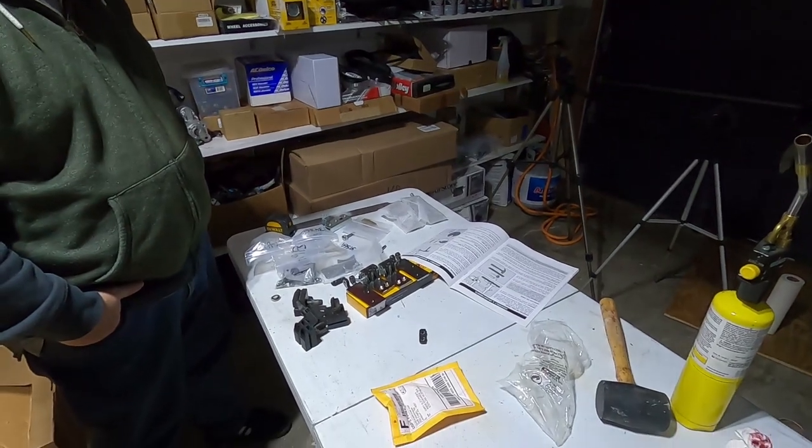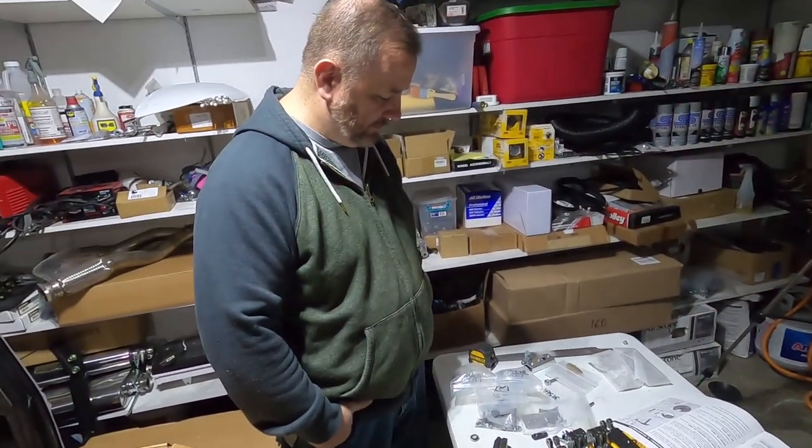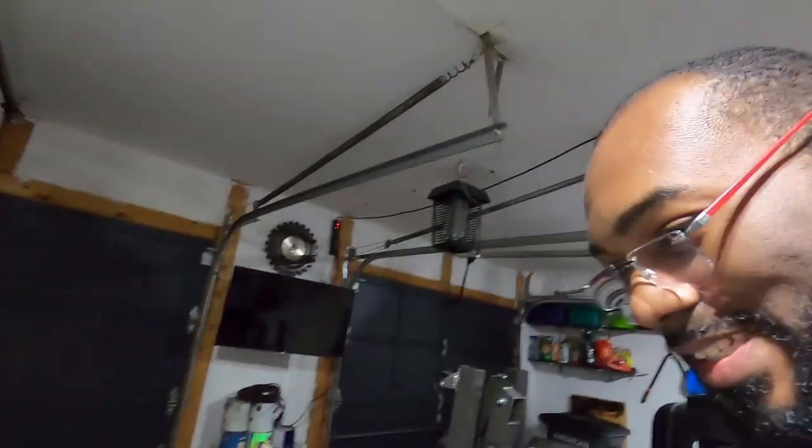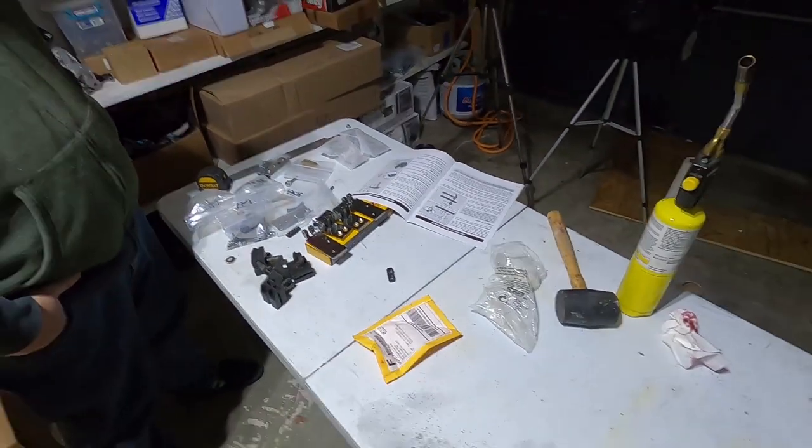Yeah, so we're gonna catch you guys tomorrow. Brian's got to go to work. We have to take time to go buy more drill bits because we didn't have the exact 17/64ths. Make sure you have a 17/64ths cobalt drill bit for these because you need to tap these ones.